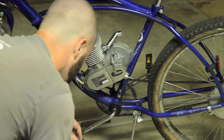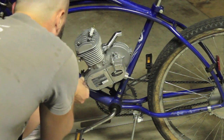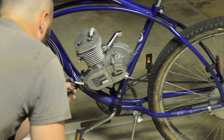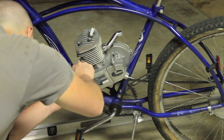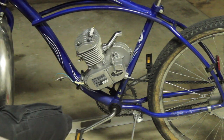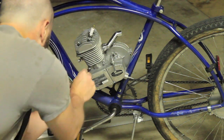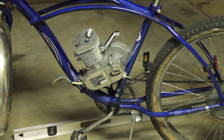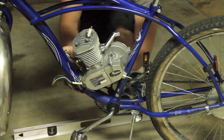The order is the same as how you put the gas tanks on there. You want to go flat washer, lock washer, then nut. And if you have lock nuts that have the little plastic bushing inside of them, that's all the better, because this thing is going to be vibrating a lot when you're riding and you don't want it to come loose. Once you've got them all finger tight you can go ahead and lock them down — I think it's the same 10mm wrench that you need. Yep, 10mm wrench.